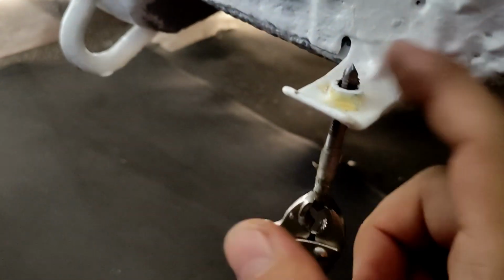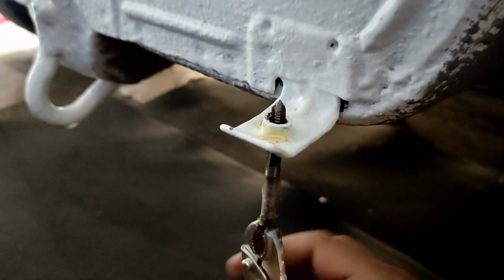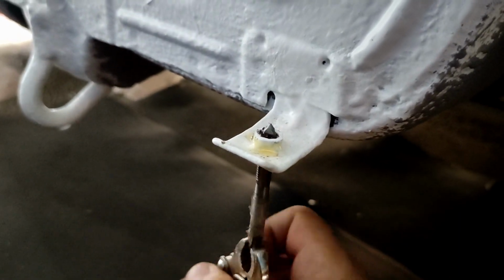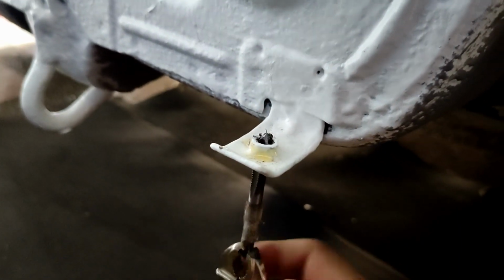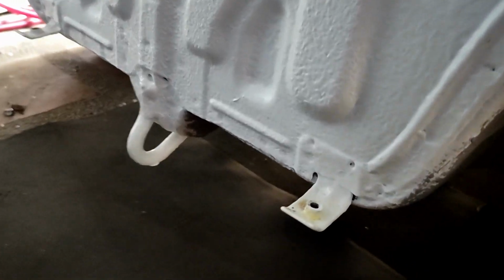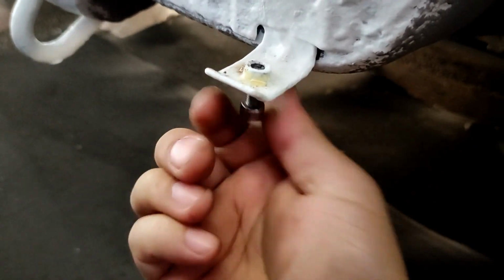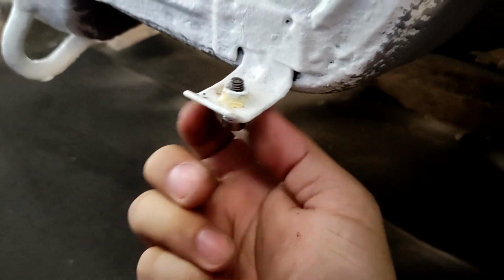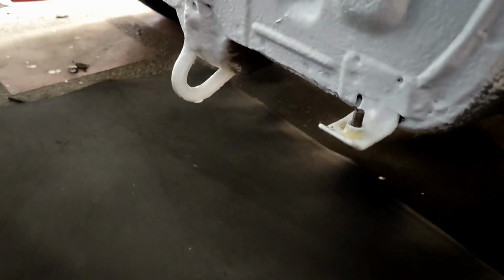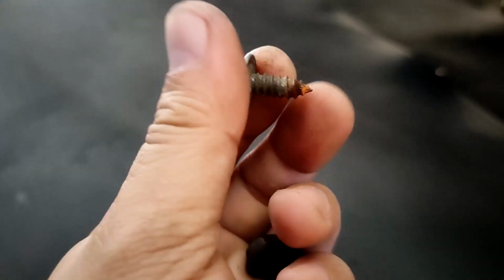It's all the way in. And it's kinda easy to turn the tapping tool for the second time. It's much easier than before, so I think this will work now. Flush it with some oil, and then let's see if the M6 will work. I'm all set. Woo.